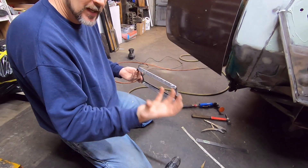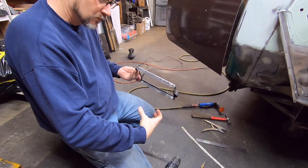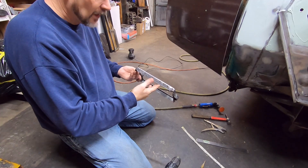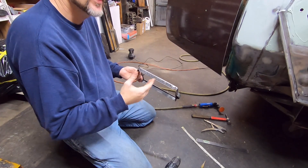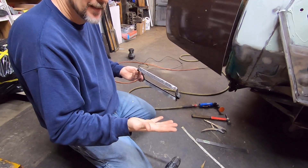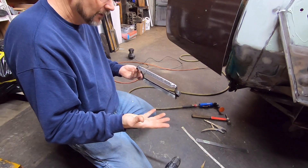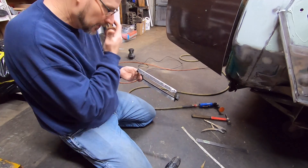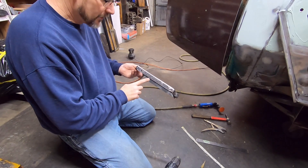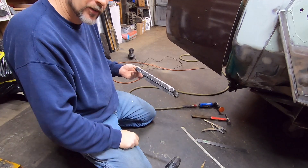I'm not really going to go that far with this car, but one of the parts I got for this that's really nice is a hood latch support brace that comes up off the splash apron to hold the part where your hood latch hooks into on the grille. I have that whole bracket speed holed - I did one for my hardtop, then I lost it, so I drilled speed holes in another one, and then I found my new grille for my hardtop and forgot all that stuff was still attached to it. The other thing I might drill speed holes in for this car is the top grille bar. I may drill speed holes in that because I did it to the hardtop and it looks really cool.